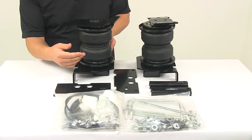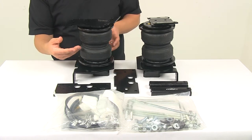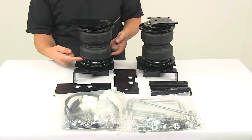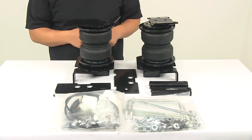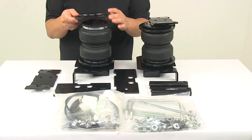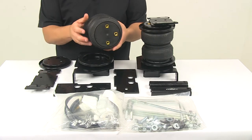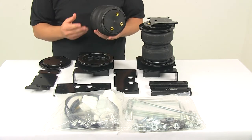When it comes to the construction, we're looking at a really nice two-ply fabric-reinforced rubber air spring design — they're very durable. It also features Air Lift's exclusive upper and lower roll plates, which protect the air springs from damage, extending the life of the suspension system. Located on top and bottom of each spring, you'll notice the end caps — these are high-strength Zytel nylon end caps, lighter, stronger, and more corrosion resistant when compared to steel.